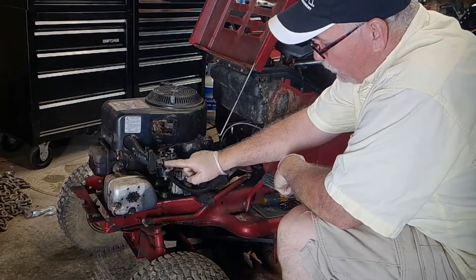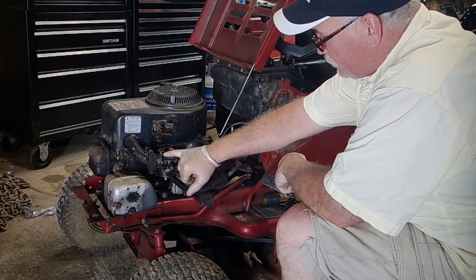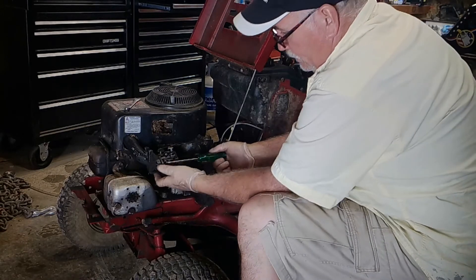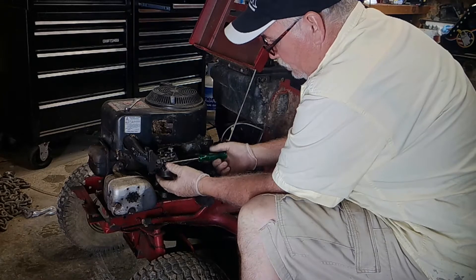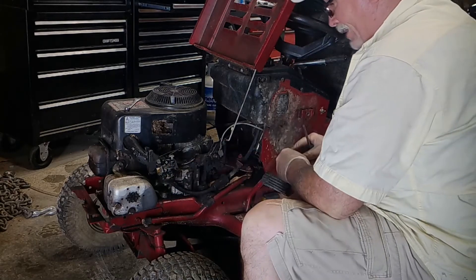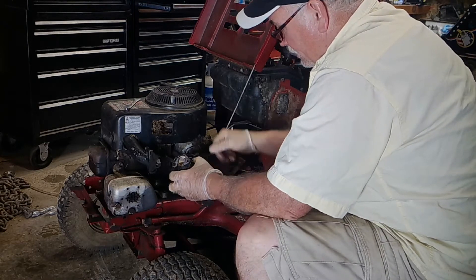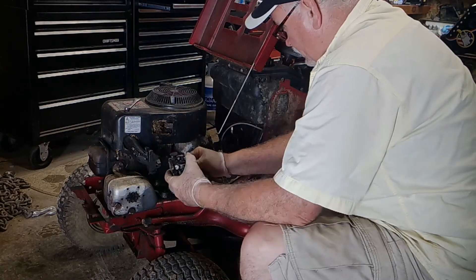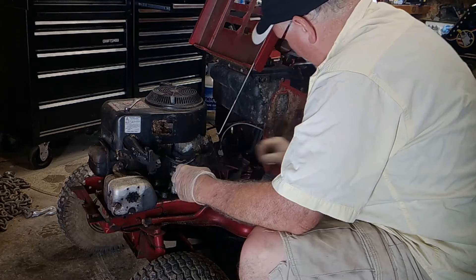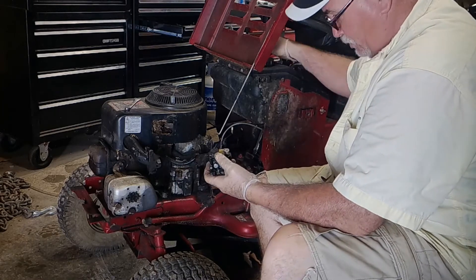We've got to take these two bolts — I mean the nuts — right off and slide this carburetor out, unhooking the linkage after we unbolt that. So let me get a wrench. Actually these do have a Phillips head on them — they're not nuts, they are screws or bolts. Use a 3/8 drive or a 3/8 wrench or a Phillips screwdriver. Took those off; in this particular model we are now going to unhook our throttle linkages. Gas is already shut off.